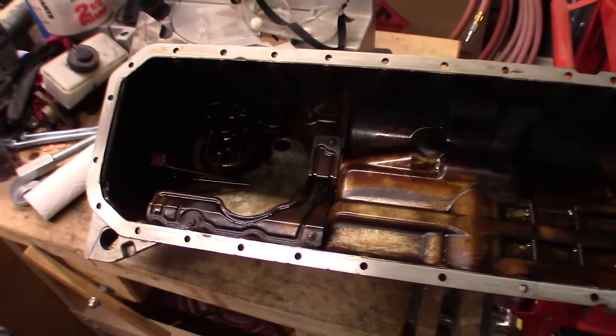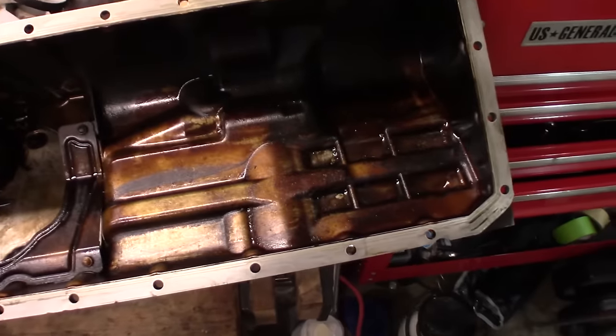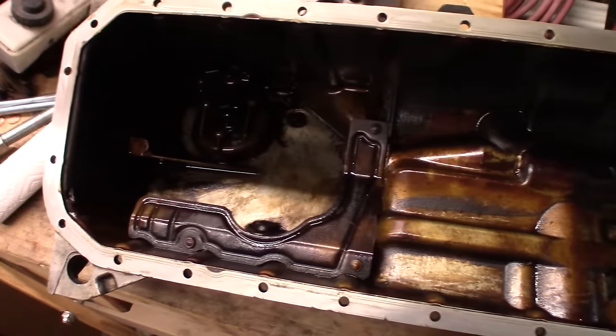It's really just the power steering pump that's in the way, and the ATF cooler hoses are also sort of binding things up. I've been cleaning up the pan a little bit — it's pretty gunky. The previous owner probably didn't change their oil often enough. I'm going to hit this thing with my pressure washer both inside and out and get some engine degreaser to dissolve a lot of this.